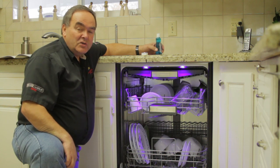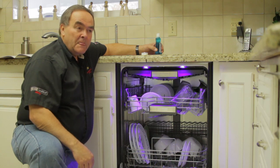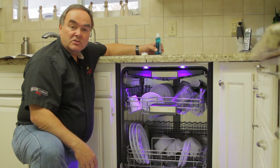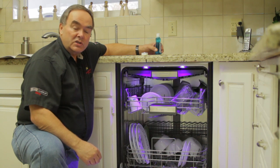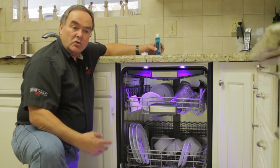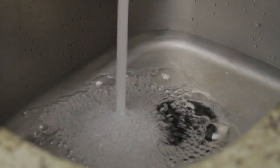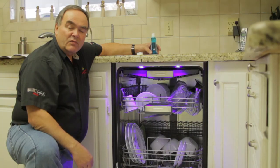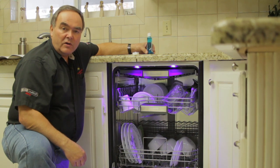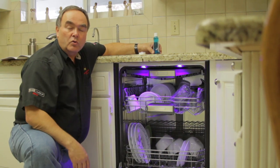Today's dishwashers are highly energy efficient — they're regulated by our government on how much energy they can use. Our water heaters have also been changed so that we can't bring in as hot temperatures as we used to. Dishwasher manufacturers have engineered new technology to help you get good results. One key thing is to make sure the incoming water to your dishwasher is as hot as possible. In some cases you may even want to run the water at the sink until it's hot before you start your dishwasher, to ensure a good hot fill from your water heater. There's sometimes a distance between your water heater and your incoming fill line that's full of neutral or cooled water.